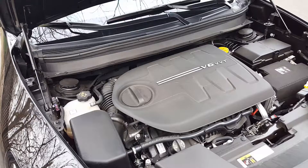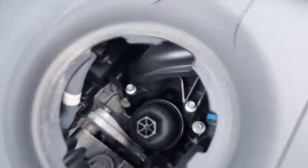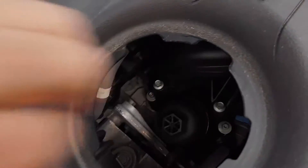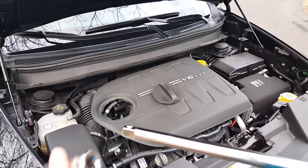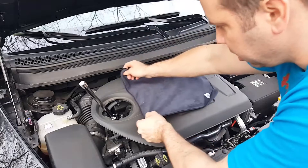Make sure your car is nice and warm. Remove the engine cover. You're going to need a 24-millimeter socket to go over the filter housing. You just latch onto that nut, turn it counterclockwise, and take her out very carefully. I like to use a 10-inch extension. Put your socket on here like that, and I like to put a rag here.